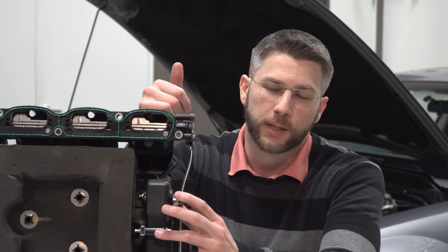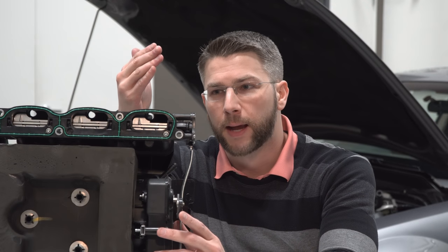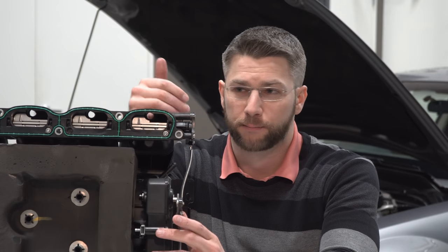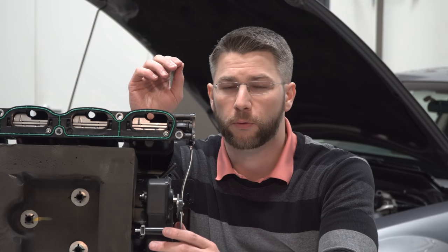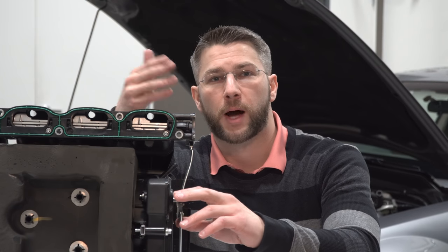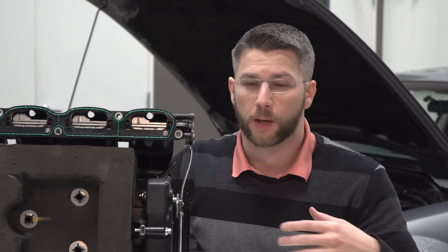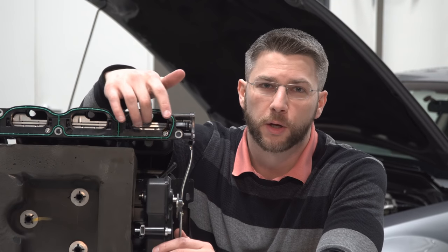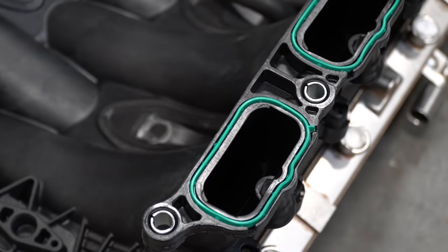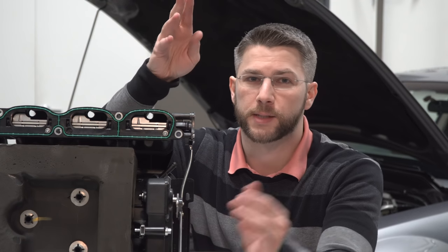This hole right here is where the injector sits — this is where fuel's coming in. So when you get that air coming in at a high rate of speed, and you get the fuel injecting at a very high rate of speed — these injectors squirt fuel out at very high PSI — when they're closed or you have a high airspeed, you're going to get a better mixture, a better explosion, and more torque. Now you can imagine if at idling or low speeds these control valves were completely removed, the injector is basically going to shoot the fuel onto the sides of the intake port, it's just going to leak down, and you're going to get a poor combustion.